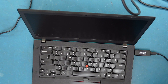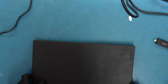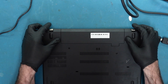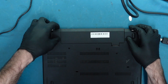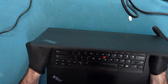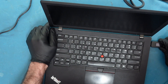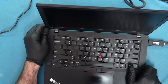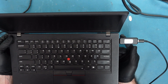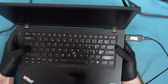What we're going to try next is reinitializing the internal battery. I'll unplug the laptop and remove the external battery — the good battery — to isolate the problem internal one. With just the AC adapter connected, the power meter is only showing 20 volts and no amps whatsoever, so it's probably not going to charge anyway. Let's turn it on and check.